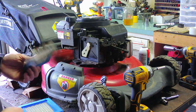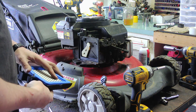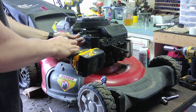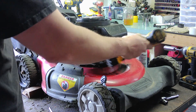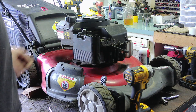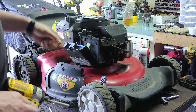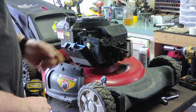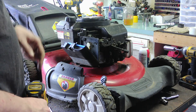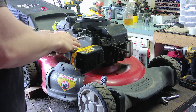Now it's taken care of. The air filter came off — it's not horrible, but we'll replace it with a new filter. By the way, that's the correct spark plug. I did have to tighten the bowl nut on the carburetor. If it starts to overflow out of the throat, your needle's bad. If it's coming out from just the bottom, your gasket or the seal on the actual jet is bad. The top was dry, so when I felt down there it was just a little wet — it just needed to be tightened. Not too tight, but just tight enough.